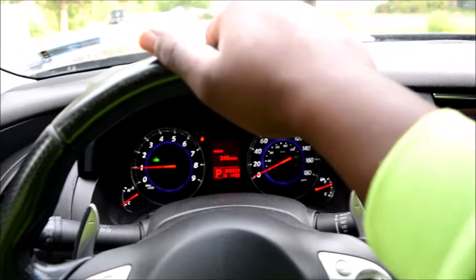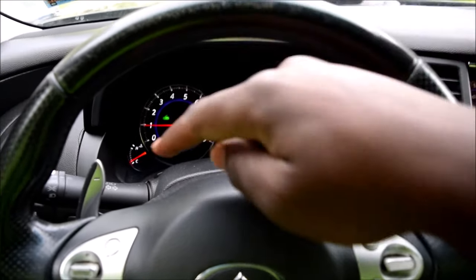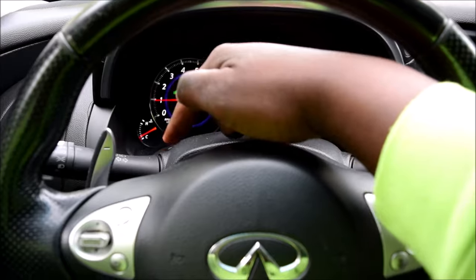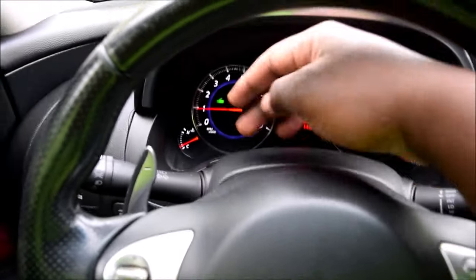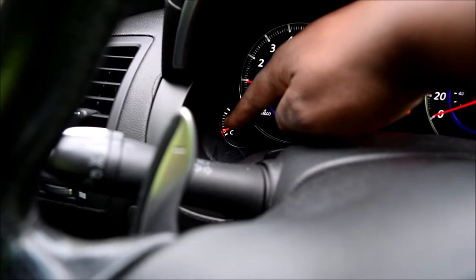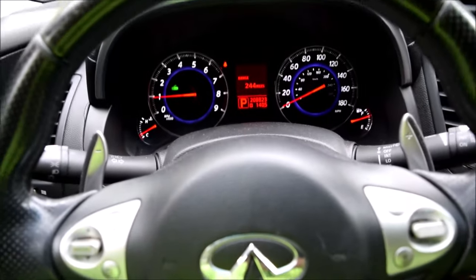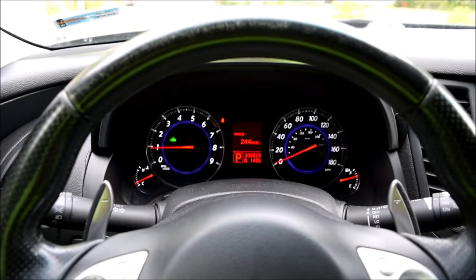Is that a big concern? Not yet, not quite. You have to pay attention to your gauge cluster — my engine coolant temperature indicator. For most of these Nissans, the normal resting level is a tick below halfway. I've been checking my gauge cluster and everything is normal. Let me rev it — let's see if that sound will carry.